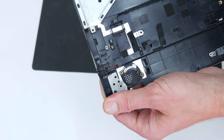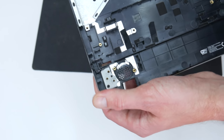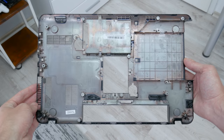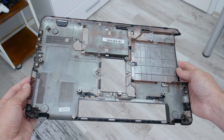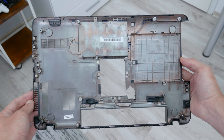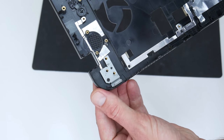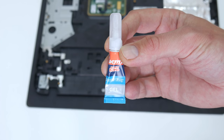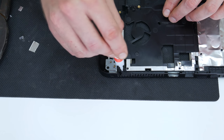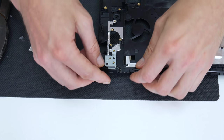Now let's do some repairs. The laptop's upper case is damaged mostly in the upper part around and under the display holders. The bottom case has some damages but nothing very serious, except the screw mounts in the upper part which are very important. To fix the upper case I will use superglue gel, which dries slowly but is stronger, more flexible, and won't damage the plastics.